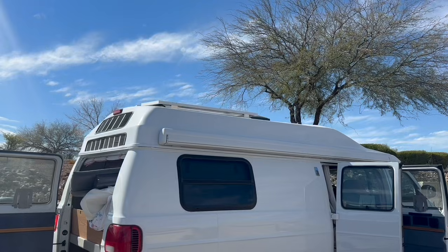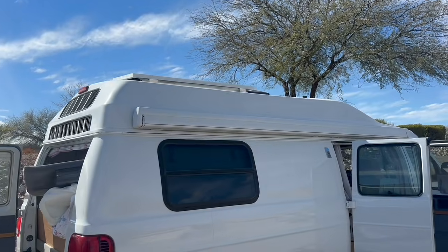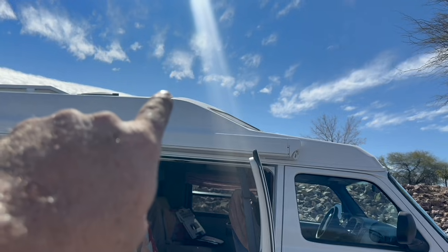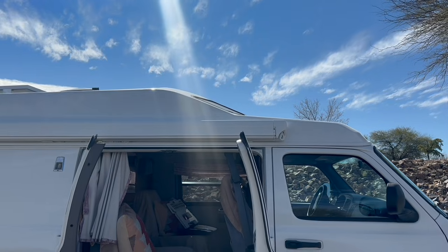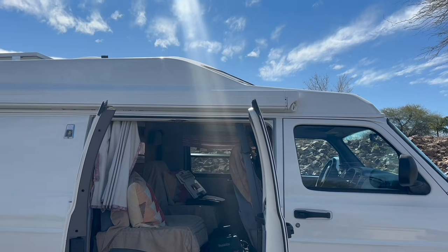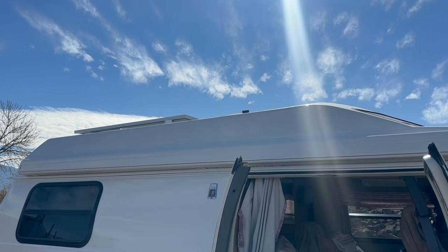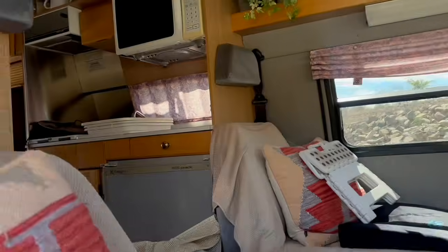Things are moving right along — we've got 200 watts up top now, and here's the reason why. You can see the curvature of the roof as it goes up. The 100-watt panel would have generated tons of lift because it had overhang on the left and overhang on the right. I've removed panels off vans before because of this lift — you can feel the shuddering as they're driving along. I had to talk with the customer and we ended up deleting that panel, but we still got 200 watts of the slim panels in the back working like a champ.